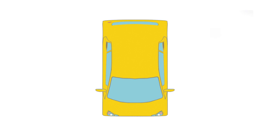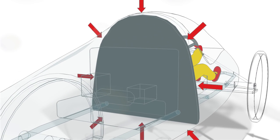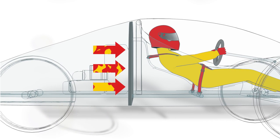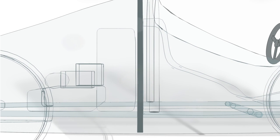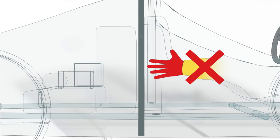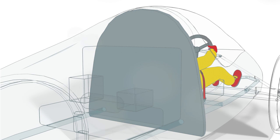The bodywork needs to cover all mechanical parts when viewed from above. Your vehicle must have a bulkhead to completely separate your driver from the energy compartment in the event of a fire. There should be no manual access from the driver's compartment to the energy compartment. The bulkhead should be made from a fire-retardant material, like carbon fiber or sheet metal.